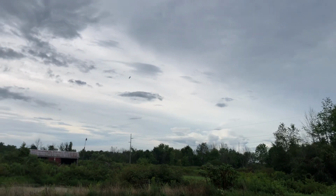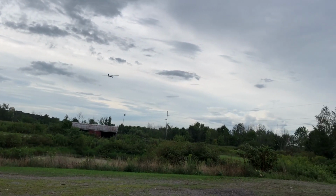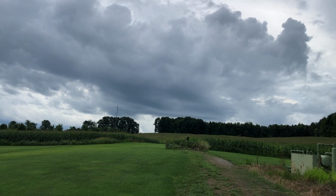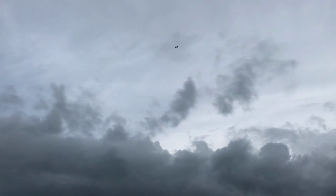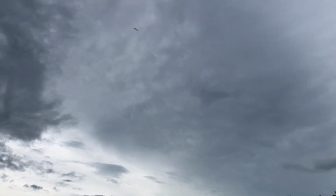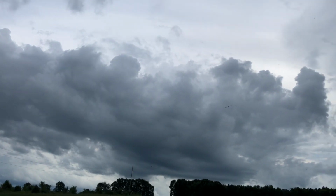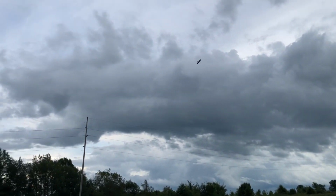Could you do a slow flyby and punch it up? Seems to idle and run really, really nice. Running a 10.6 prop on it. Running a fuel oil mixture of 20:1. I think they recommend 24:1, but because it's new, I went a little heavier on the oil.